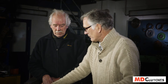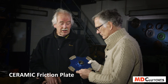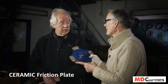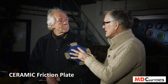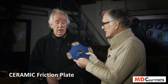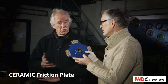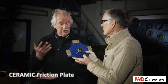We then had requests from racers — circuit racers — for clutches for their cars. Here we've got ceramics, which have an extremely high coefficient of friction but are very unkind to metal surfaces. If you use these plates for race purposes, your flywheel will get very badly marked, as will your pressure plate, and you would really need to refurbish all three to get back to the right plane again. So when we supply these we're usually asked for a flywheel as well as a pressure plate — all new and all sorted out, so they can take the wear from these hard plates. Lovely material but it does a lot of damage and is not good for road use — really just for on track. When you let the pedal out and it bites, it's almost like it's in or it's out. There's no feel — it's for race purposes.